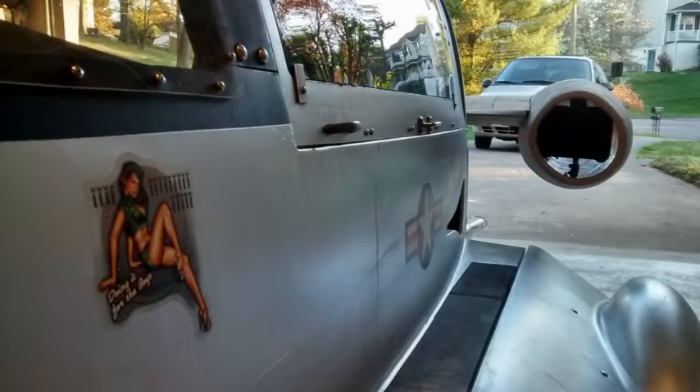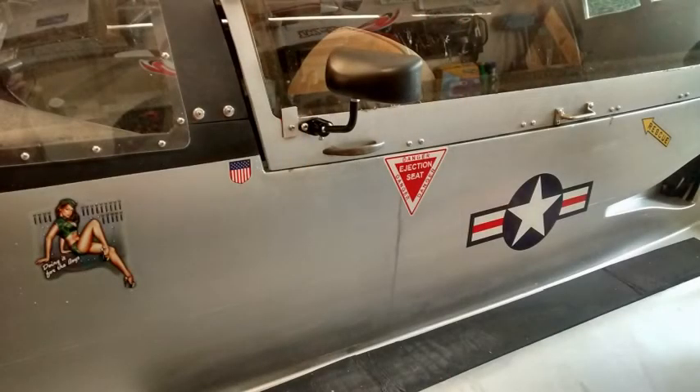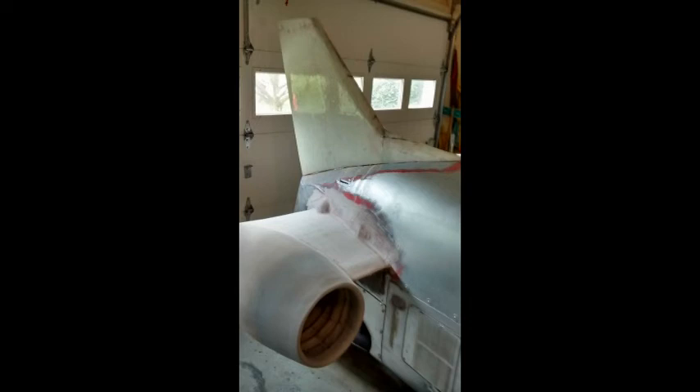You can see the radiator inside that jet engine nacelle, so cooling was no problem. I did want a tail on it, so I started fabricating some tail feathers using foam, epoxy, and glass cloth. Added some stickers here and there, new little mirrors. The strip up the center is an aluminum extrusion for strength, on the vertical stabilizer.